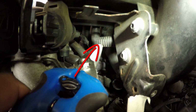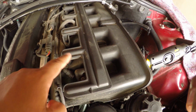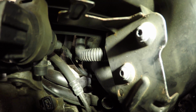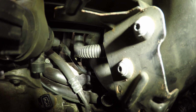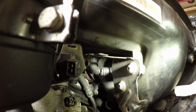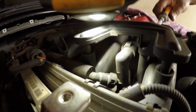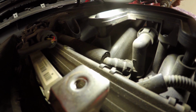The next pipe we have to deal with runs into the side of the CCV valve. That's the other end of the pipe there that goes into part of the air distribution manifold, this thing here. And so Jason reckons just cutting it, because it's not a straightforward reconnection, it's a twist. Make sure you're cutting the right pipe, and let's go for it. And you can see how brittle that pipe was. Obviously there's a bit of oil because it's a crankcase breather. We can then do the same thing. We'll be able to see how I did this for the other one. So just break the tab, pushing the screwdriver in and twisting.